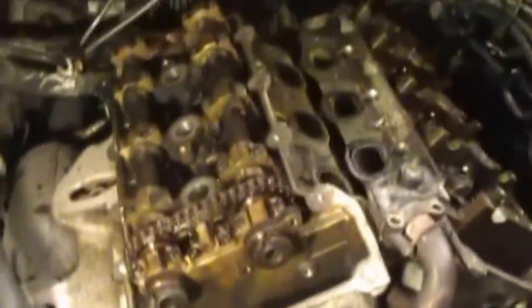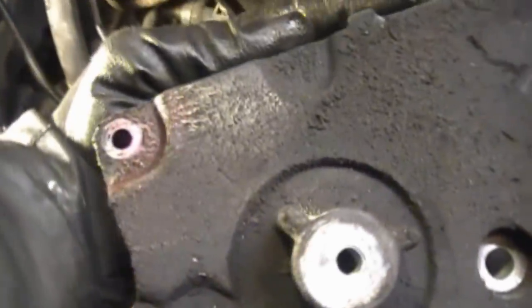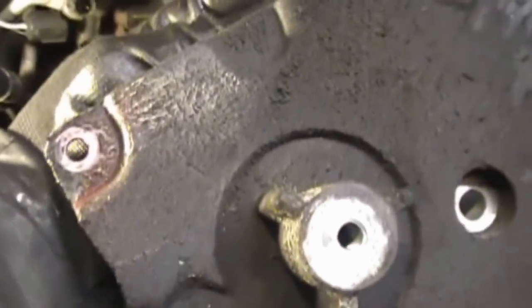After I got the plenum off and the valve covers off, I went ahead and took the front cover off. It's pretty easy to take off. There's one little bolt that is a star - it's right up here in the top left-hand corner; I marked it with some paint. I believe it's a T20. The rest of the bolts are just 10 and 13 millimeter. Once you pop that cover off you're good to go.